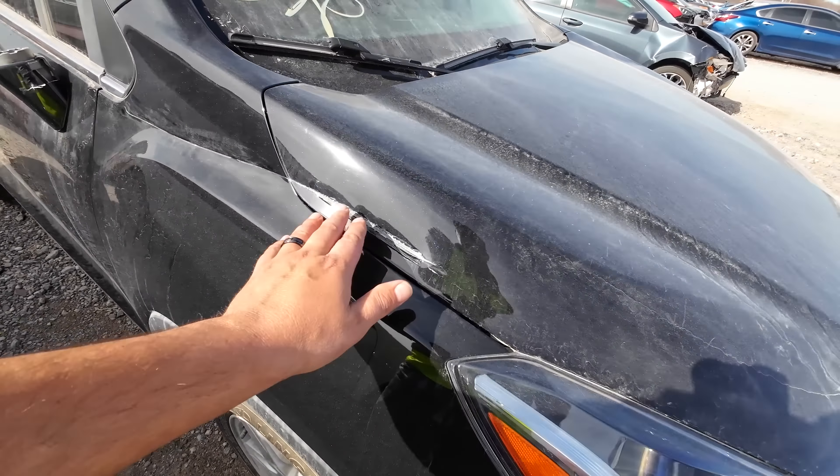She's got aftermarket gauges — white face gauges with blue needles, that's nice. She's got juice. Got an aftermarket dual head unit. Make sure she's in park — she is. 222,000 miles. She's got a little exhaust to her too. Check engine light came on instantly. Oil pressure looks good, she's out of fuel, battery voltage looks good.